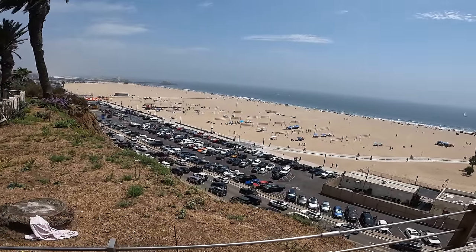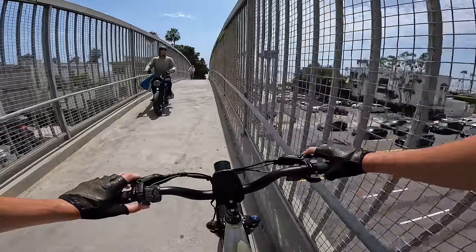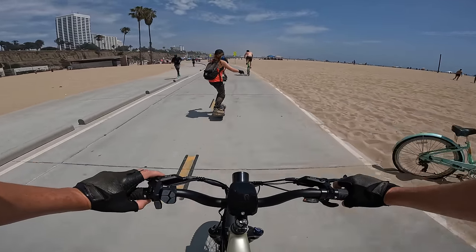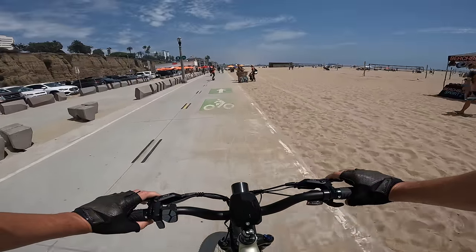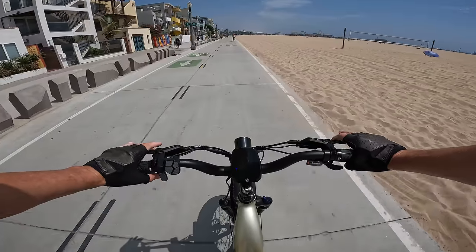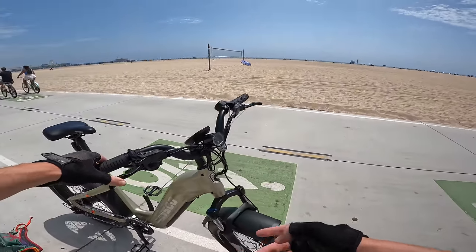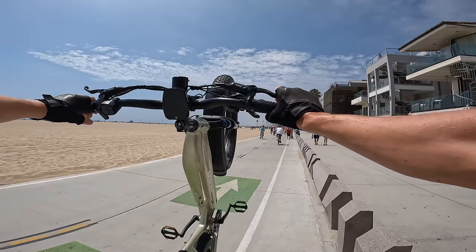You can see the pier just a little bit in today's video. This is a fun bike — underpowered bikes are the ones that are not fun. Brake test from 20 miles an hour. These are great brakes — 180 millimeter rotors, Zoom levers. I really like these Zoom levers because you can hook your finger on there and they feel nice to grab. Being hydraulic, they have a very smooth, linear, predictable, and strong power delivery.